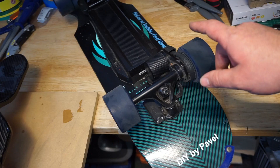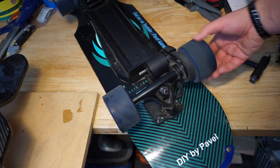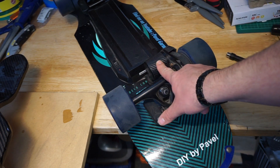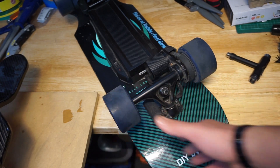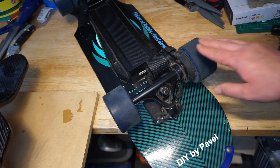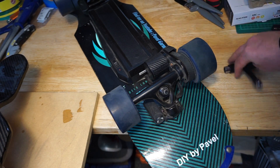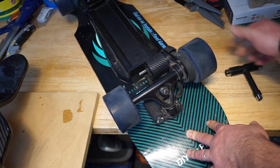Now, how about the driven wheel? In the case of the driven wheel it's a bit harder to tell just by spinning the wheel, because obviously you have the resistance of your belt and the resistance of your motor. The wheel next to it spins freely with no wobble. So the only thing you can do on the driven wheel is: when you put the nut back on, you'll feel that when it's not tight the wheel is wobbling about.